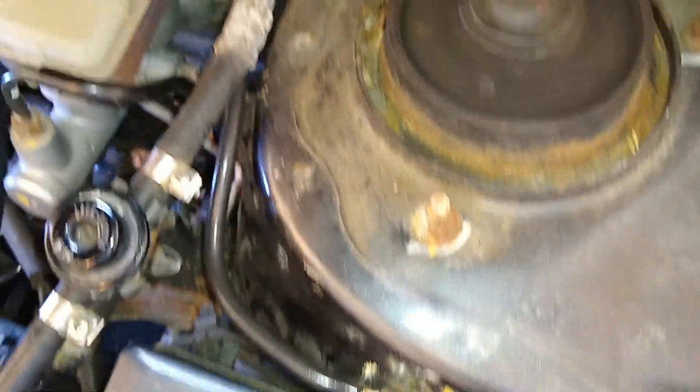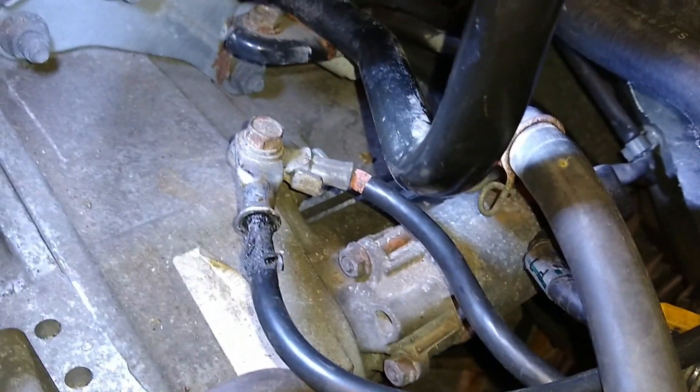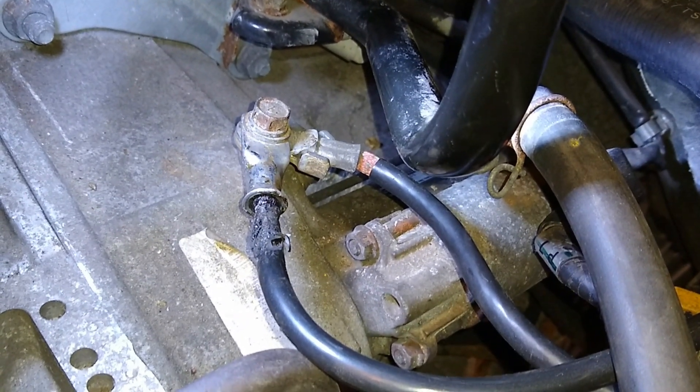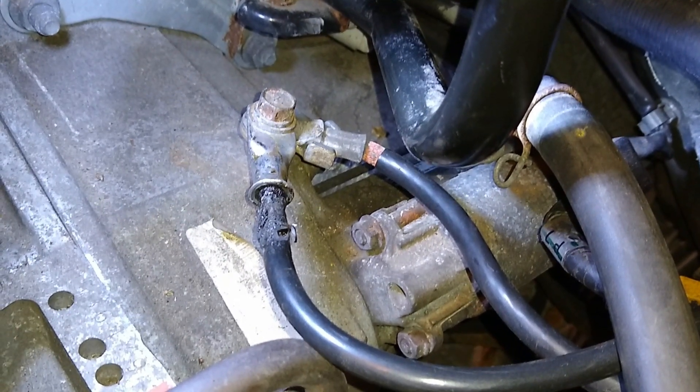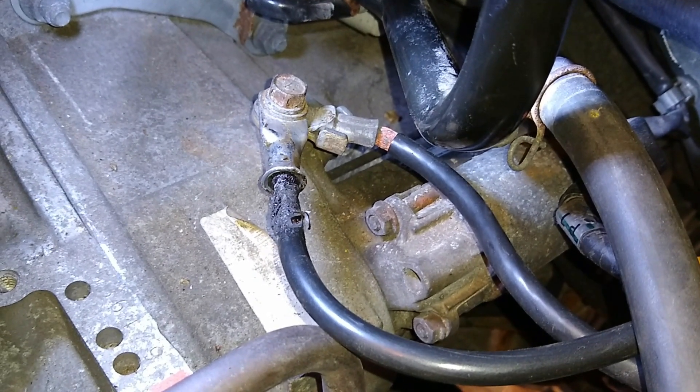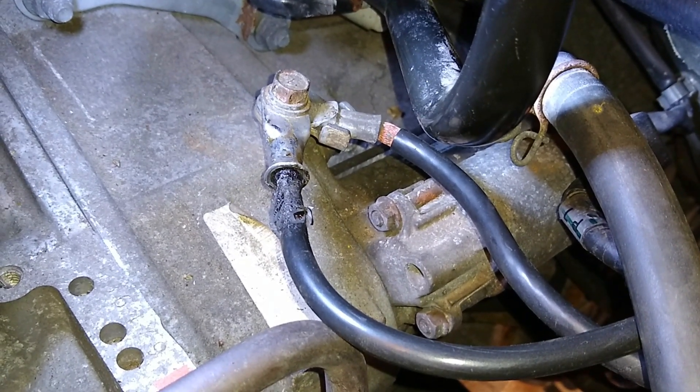Of course, we now know that made no difference with this particular engine misfire problem. The braided ground straps I replaced last time — when I had multiple random, seemingly unrelated OBD2 fault codes — must still be in decent condition and doing a good enough job. But this new heavy-duty ground cable from the engine to the chassis will serve as a backup against any similar grounding problems in the future. I hope this idea helped someone out — thank you for watching, please like and subscribe.